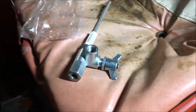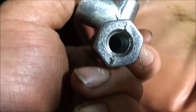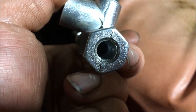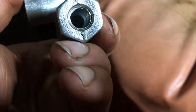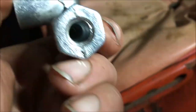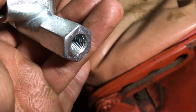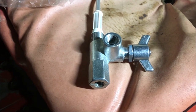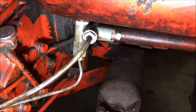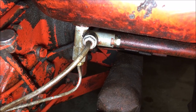Well, we ran into a little problem with the shutoff valve. The new one — the hole in there is drilled a little bit too large, and the compression ferrule on the fuel line goes right down in there and it doesn't compress with the nut on the line. So we'll have to get in contact with where I got that. For the time being, we put the old one back in and put a plug in where the handle goes in, instead of that piece of wood.